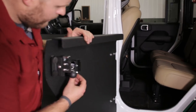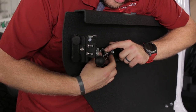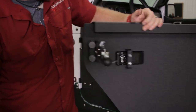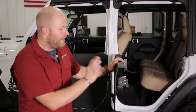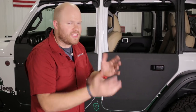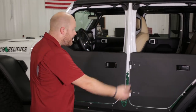For the rear door, this cable is going to be loose on the paddle end — just tighten that nylock enough so it doesn't rattle around but is still loose — and it's going to be tight on the ball end, pointing towards the latch. If you're having any issues with the doors opening with the paddles, check the alignment and adjustment on that cable. If you're having any rattling of the doors once they're closed, adjust those bumpers towards the center of the Jeep or your latch towards the outside. It's always a balance between those two so it closes softly, slams closed, and doesn't rattle going down the highway.